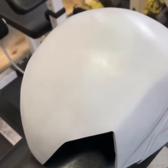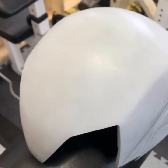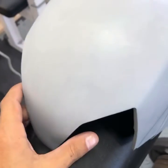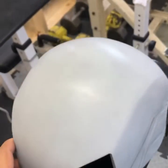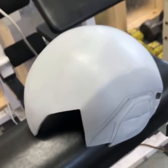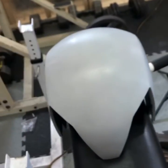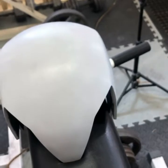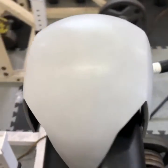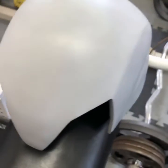So tons of different ways to skin a cat, but I prefer to use glazing putty over using a lot of filler primer because it's just a lot more efficient and better. So what we're gonna do is get this guy set up. We're gonna wipe it down with isopropyl alcohol, do its final layer of etching primer, and it will be ready for paint. Get it set up, get it primed. I'm gonna move these painted pieces out of here because you never want to prime when you have painted pieces in. So I'm gonna get some stuff moved around here and get this bucket going.